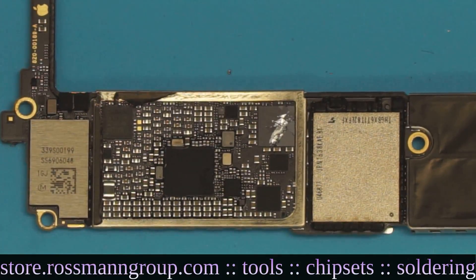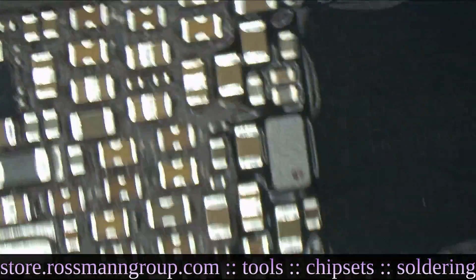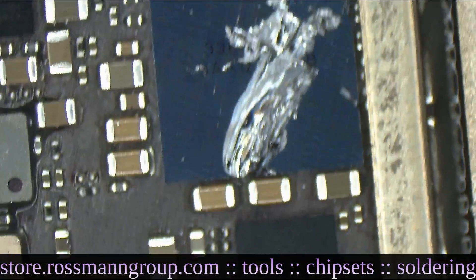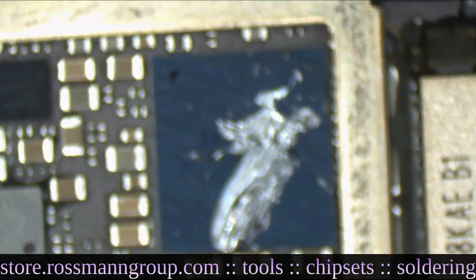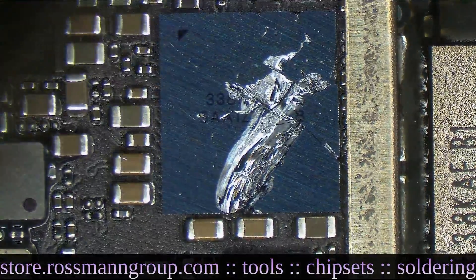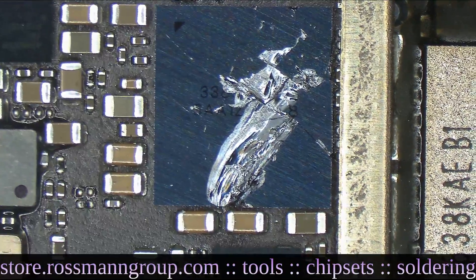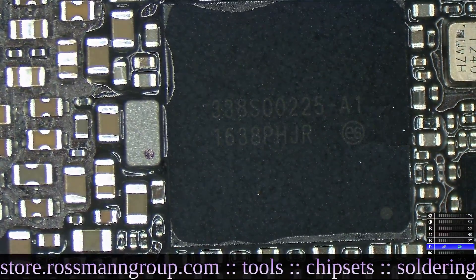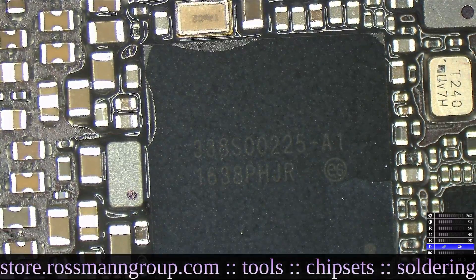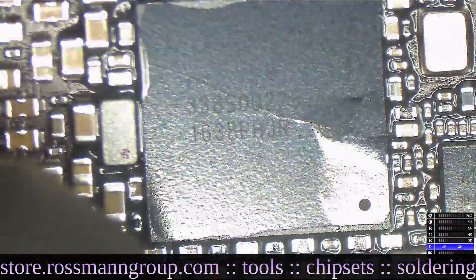Switch back to that. If I go into the microscope, you'll be able to see what happens from that one single drop. This was sent in for data recovery — look at that. That is one beautiful pile of $600 device engineering right there. I believe this is the PMIC over here. If you view it from an angle or increase the brightness, you should be able to see that it's actually cracked in four sections. No part of this phone was shown any mercy from that drop.